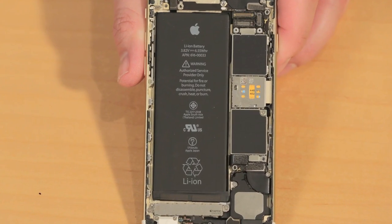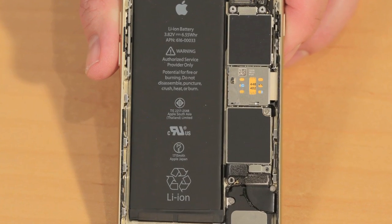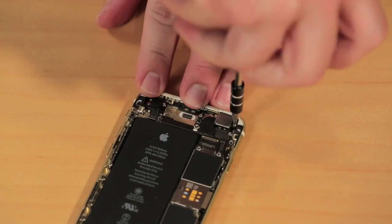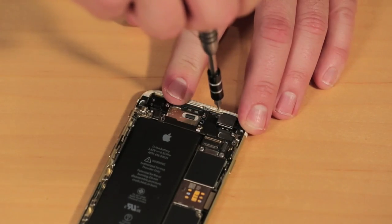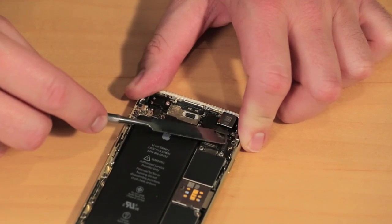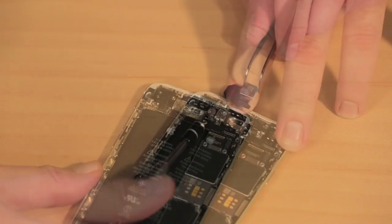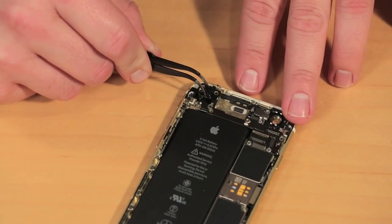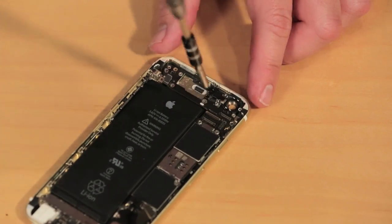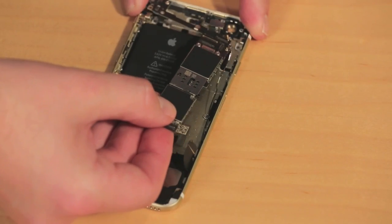While I would usually remove the battery as part of our teardown, I'm going to leave it in place as I remove the other components — this will keep me from having to glue it back in later. The first component to come out is the new iSight camera, which has been upgraded to 12 megapixels and can now shoot 4K video at 30 frames a second. A small antenna comes out next, and then, after removing a few screws, dealing with a new hex head standoff, and disconnecting the remaining connectors, we can lift out the motherboard.